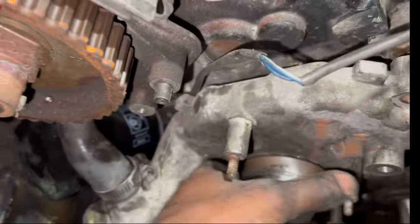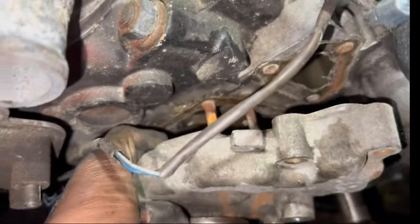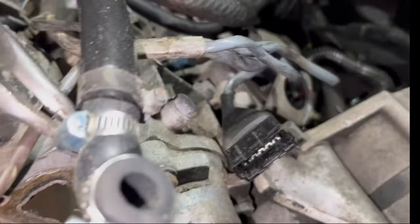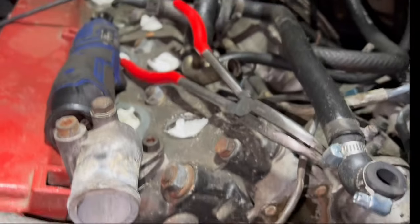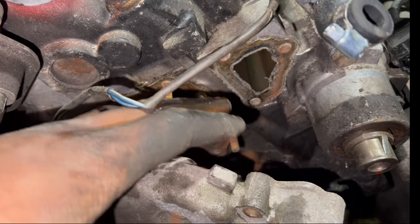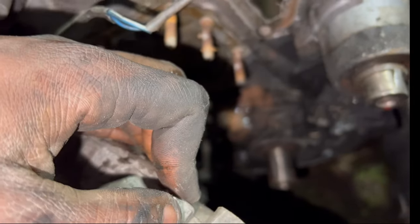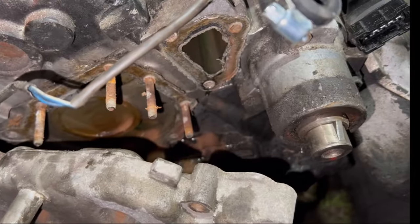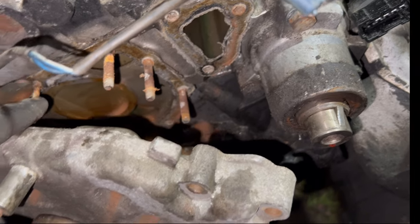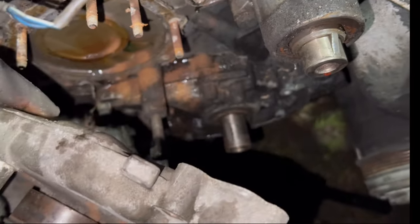Now I'm thinking it was the starter the whole time. I checked the battery voltage, and it was good. It was just a weird situation. Thinking back on it, I just couldn't pinpoint it. It had to have been something on the ignition side that was causing the car not to crank over, because when I got the car back to the house, the engine spun so clean with no issues. The new starter I had gotten had broken on me, so that was a bummer. And I had tested the ignition switch, which turned out to be bad.